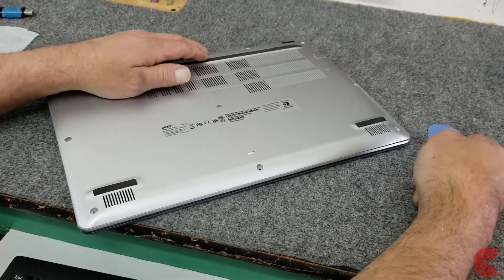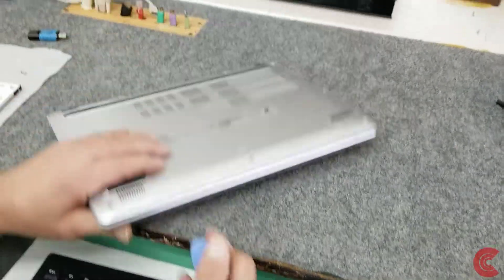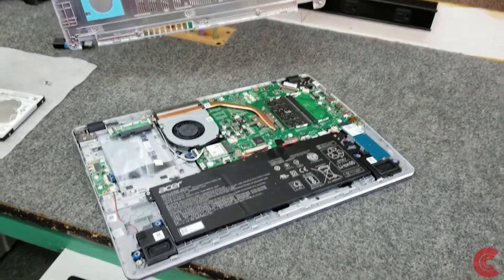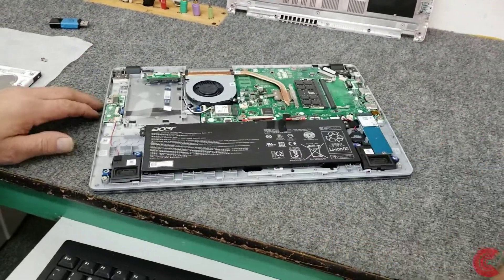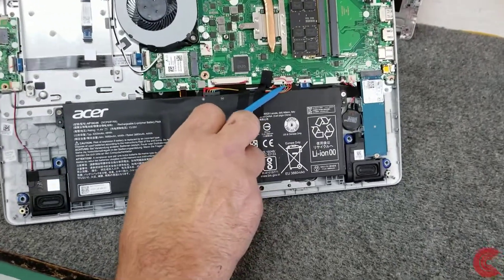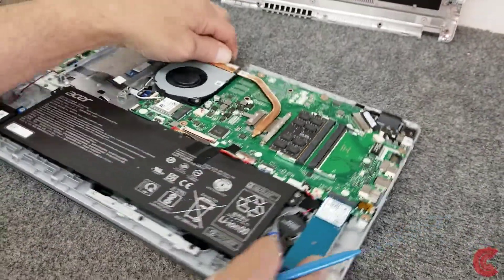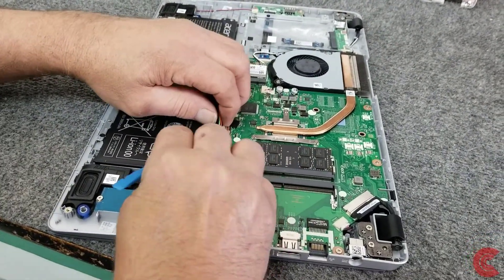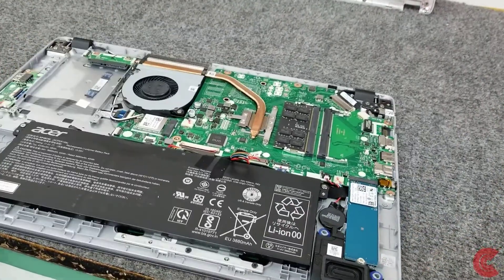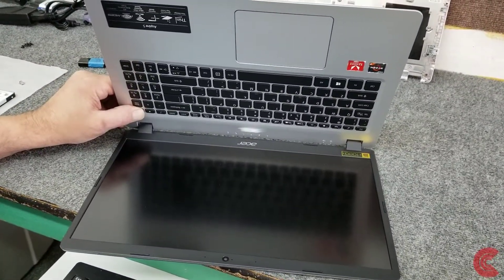Sometimes along the front here it's a little tricky. Always remember you've got a screen on here — don't be squeezing and squishing down on your screen. Now that we've got it started, usually they come off without too much trouble. I'm going to set that out of the way, then take my other little plastic tool. The first thing I want to do is disconnect the battery, which is right here on the motherboard — it just slides back out. We're going to be poking around in here and we don't want to drop any tools or screws and ruin something. Be careful doing this on these little wires. Got the battery disconnected. I'm going to flip it open carefully and hit the power button a couple of times to discharge it, just to make sure.